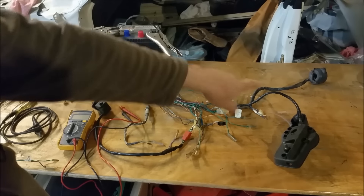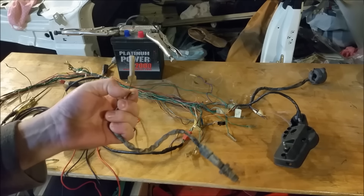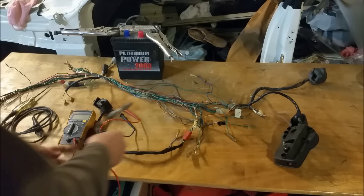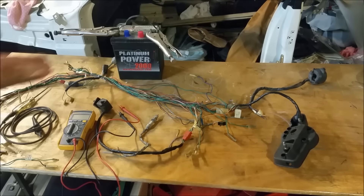I've got our combination switches on, we've got our ignition switch on. There's the other combi there. We haven't put the rear brake light on — I don't know if that works; it's got a broken terminal which we can solder up. We've got that damaged wire in there, which has been soldered before. So this is a 6-volt system and we're going to pump 12 volts through it. But we haven't got any ancillaries on — we haven't got the flasher can, we haven't got the reg or rectifier. The electronic stuff's off, so all it is is switches and wires, and we can do that with 12 volts.